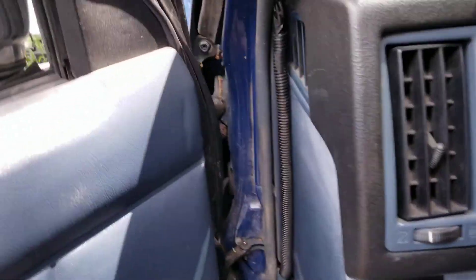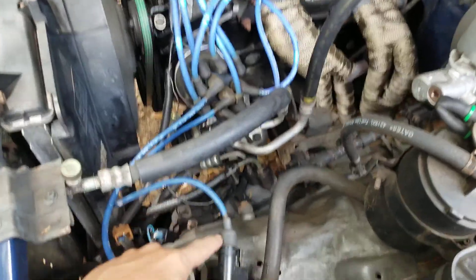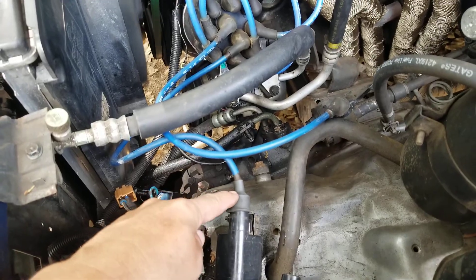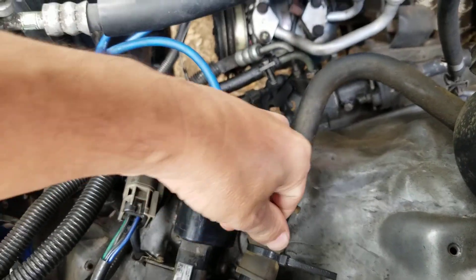As you can see, it's on and it's running without the intake side connected. That's how you know your exhaust wire is hooked up to the proper ignition coil. If you don't have that hooked up correctly, your engine will just crank over and nothing will happen — it won't actually start. Hopefully that makes sense.